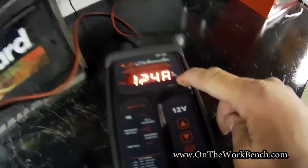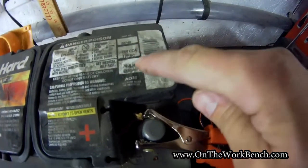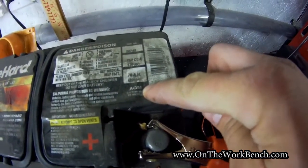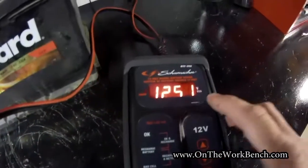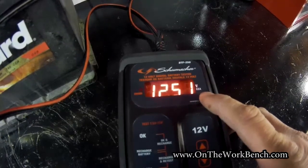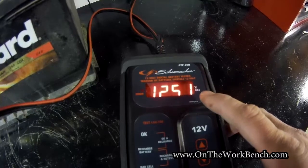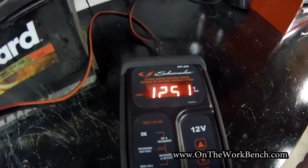Let's take a quick look at the top of our battery and note a couple things: 760 cold cranking amps, and it's an AGM chemistry — absorbent glass mat — so this is not a standard flooded lead acid battery. Over here, the display is showing the volts on the battery, about 12.5 to 12.6, kind of floating. We'd like to see about 13 and some change for a fully charged battery, so we're a little below where we'd like to be.